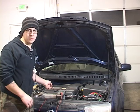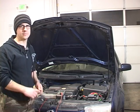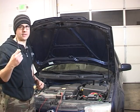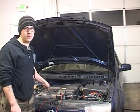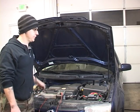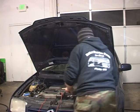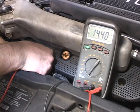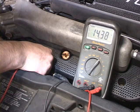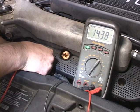The first test is to see how much voltage the alternator is actually putting out. Take the other lead and touch it to any ground, including the intake manifold, the alternator casing itself, or the negative battery cable. As you can see, we've got about 14.4 volts, which is plenty. With all the loads off, you should have a little bit over 14 volts.